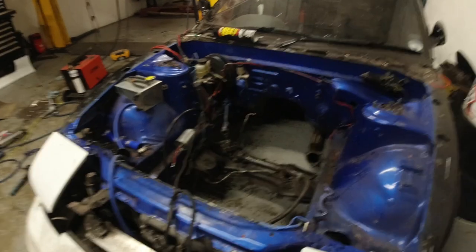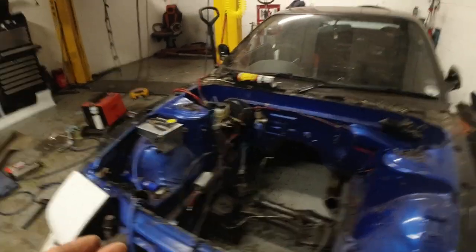I'll get into how I'm gonna mount it, do the exhaust, and don't worry — it won't be just a naturally aspirated 1.8. I am definitely gonna turbo charge it. They'll make around 280 horsepower roughly just standard, but the weak part is the conrods, so we may end up putting in new rings, new bearings, and a set of conrods so we can make sort of mid to high 300s horsepower. That's all I'll tell you for now — we'll get into all the other stuff in future videos.